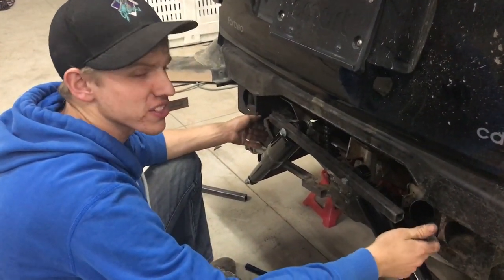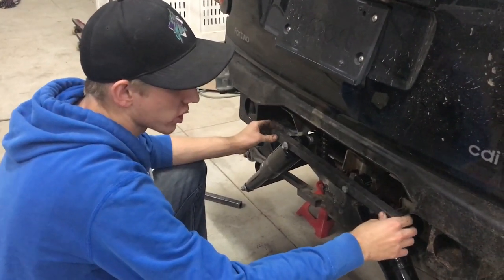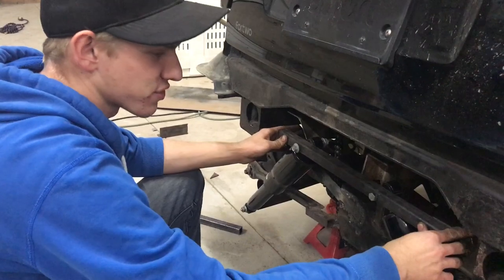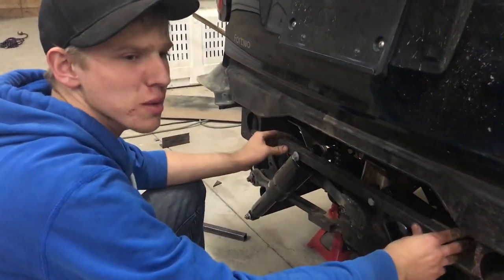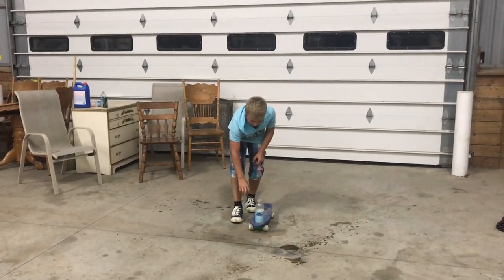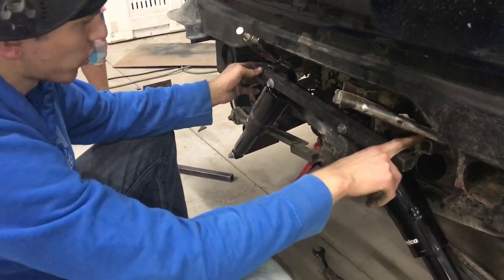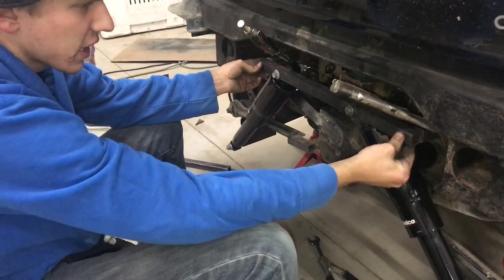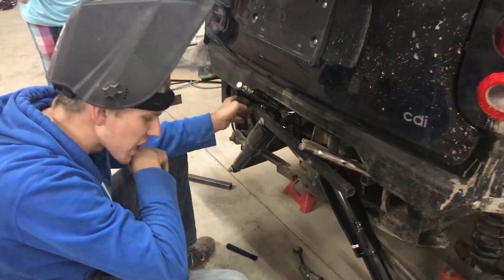I got this bar — it's got two holes in it that hold the shocks on, and it's going to weld to the top piece of the frame to fasten the top of the shocks. We also made some awesome mounts for the bottom. I've got these two one-by-one bars coming off of the motor mount and the diff mount over here, and we're just going to go off of those — tack weld that, then take the shocks out and weld those up solid.